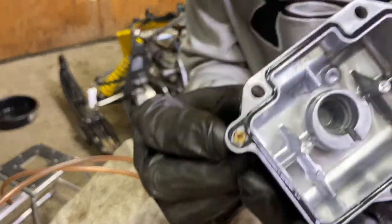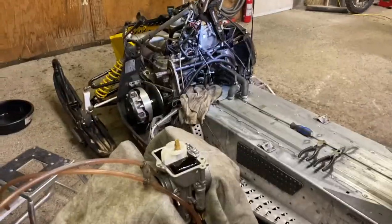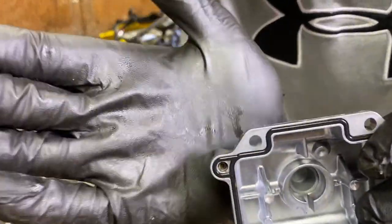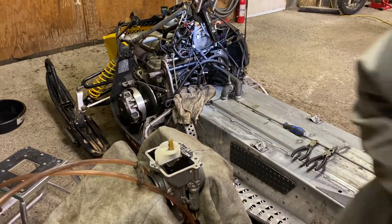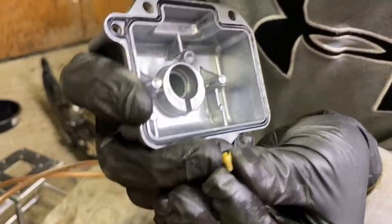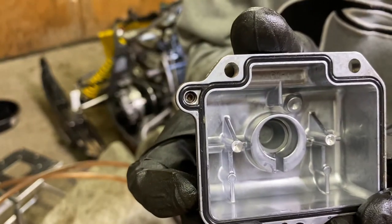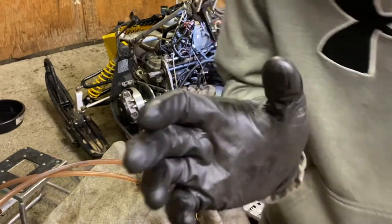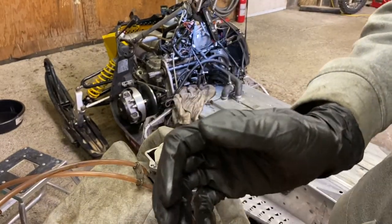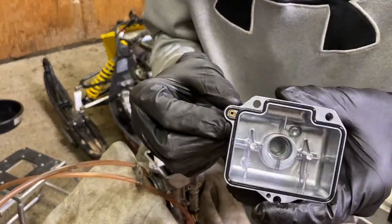People will take this little jet out and block it off with a grub screw. I just pulled the jet out with a little flat-top screwdriver, and you put a grub screw in to straight-up block it off. Because you can't just disconnect the electrical - you'll throw codes and the sled will not be happy. So the alternative is to physically block it off mechanically.